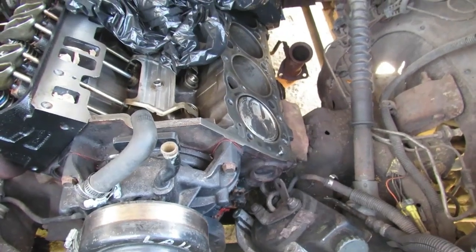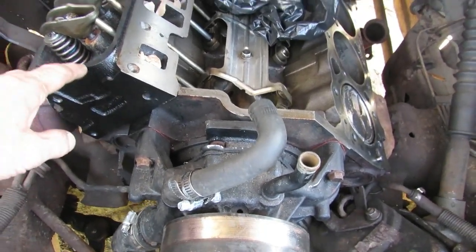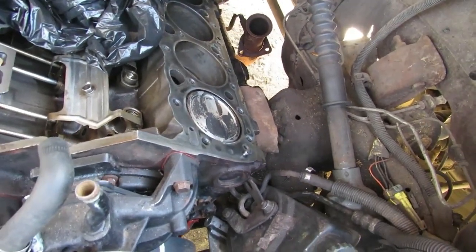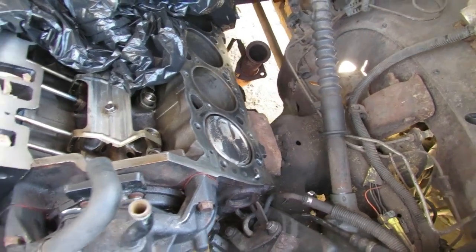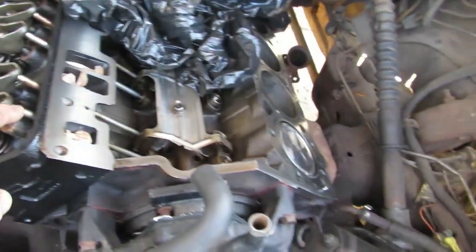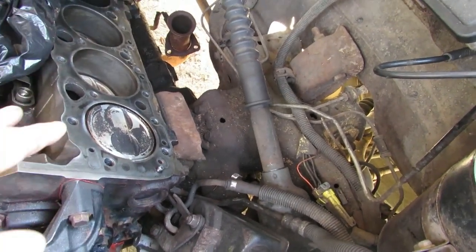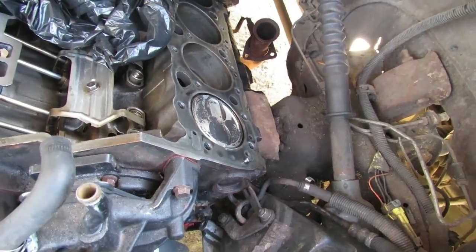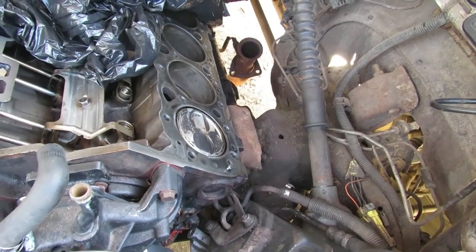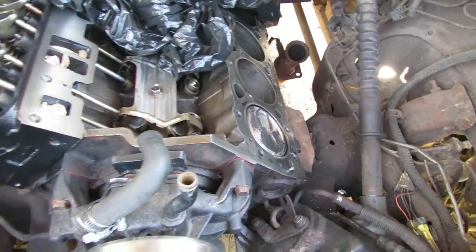I did something really stupid. On my Suburban I went to put some gaskets and parts in the back and noticed the heads were getting quite a bit of flash rust, so I cleaned them up, painted them, and took them inside to dry. When I went to bolt this head back on, I mistakenly grabbed the 5.7 head. I got it torqued down to 22 foot-pounds and was fixing to zip everything up when I finally noticed the mistake. I threw away the head gasket and head bolts - it was only $34. I don't want to do this again for a long time.